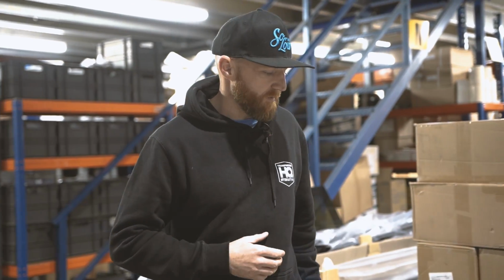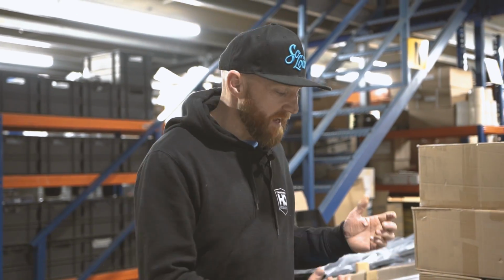It becomes really obvious when you're driving the vehicle. Darren's van here, he says when he's doing a sweeping left-hand bend, you feel it, and it's a real obvious judder. The flatbed used to do it previously, that was on a right-hander. Some people get it in a straight line, but it's a real obvious sensation that you can feel through the pedal and also through the steering wheel, would you say with yours? Yeah, you'll know if you've got drive shaft judder, but not all of them get it. But this anyway solves the problem.